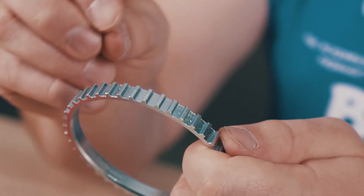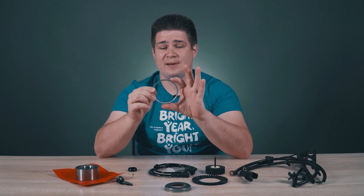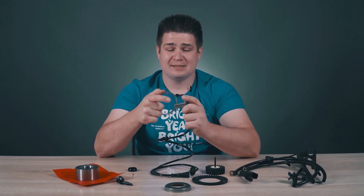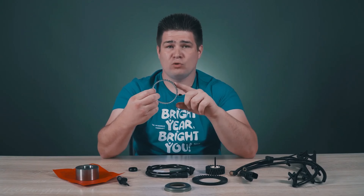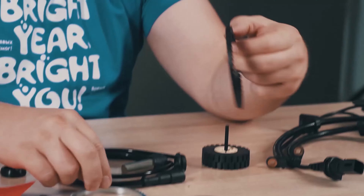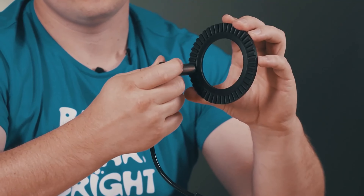This is called the ABS ring — it has depressions and teeth that alternate, and this ring rotates with the wheel. The ABS sensor is on the side with a small gap, and due to the alternating tooth or cavity the signal occurs. The sensitivity of this passive sensor starts at about 20 kilometers per hour; until that point the sensor does not send the desired signal. The reluctor ring can look a little different — the same shaped teeth can be located in another plane, where the teeth face forward.